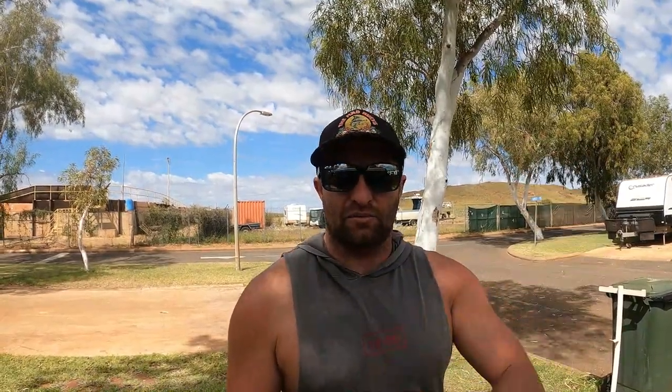We've been parked up for nearly seven weeks now. What I do with my water tanks is either keep them completely empty or completely full. I've been filling them right up and whenever we use the washing machine I flick the mains water off and just use the tank water. The pumps get used, the tanks empty and fill, keeping the water flushing through as if we're travelling full time. Don't leave them half full because once air's in there bacteria can get in.